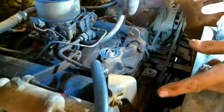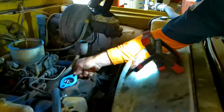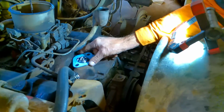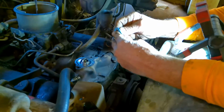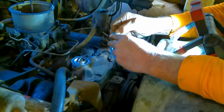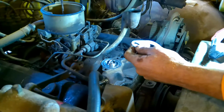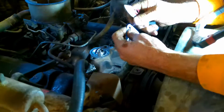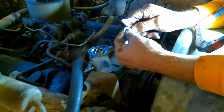Next comes the gasket. Here we go with the gaskets. Always look at your gaskets first and compare. That looks like it's the right gasket. That one will fit. Now generally you'll see gaskets that have a sticky side that you can peel. This one has a sticky side, and I like to put the sticky side down if it's got that. Let me see. It's very hard sometimes to check. You have to actually visually see if you can separate it. This may not have a sticky side.